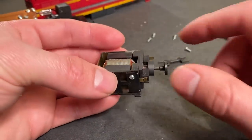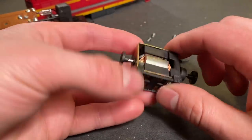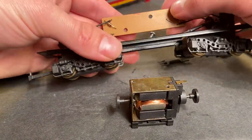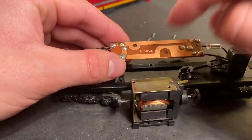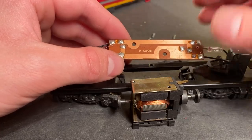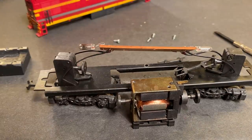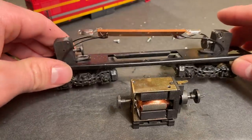So you've got your lower brush, which is right here, connects to this metal frame right here, which eventually wraps around the entire motor. So theoretically, I guess those screws up here, this screw right here, should transfer power to that. I guess there's always a possibility that it's not working correctly, but that's one place to look. This contact right here is also supposed to be touching that. This whole electrical system is not fantastic, to be completely honest.